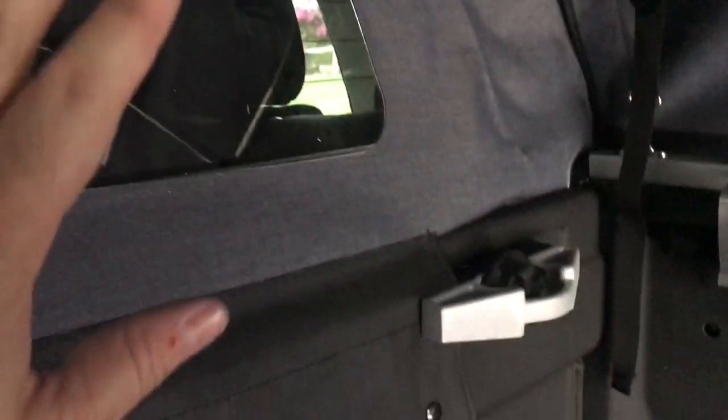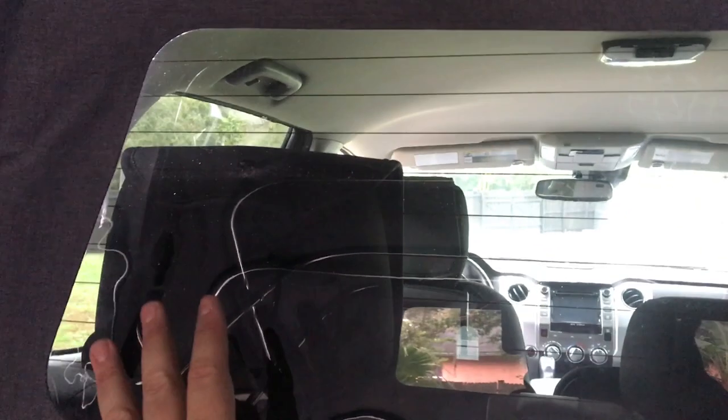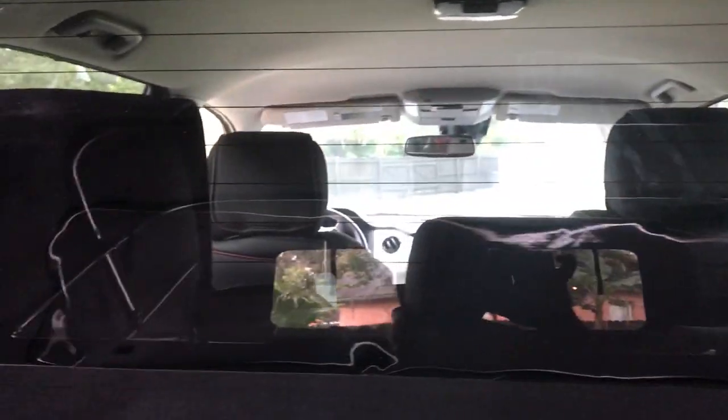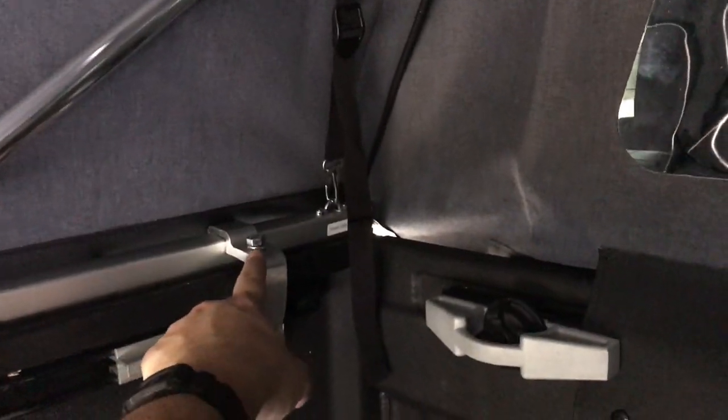On the inside, I'm doing the safety straps. Quick tip for getting the window nice and tight: if you have the utility track, loosen it, slide it out, drape the inside canvas piece through it, get a good pull on it, then tighten it down — that keeps the window nice and taut so it looks clean and clear. Now I'm tightening everything with a 9/16 — don't go crazy, this is white metal and it'll snap if you overtighten.